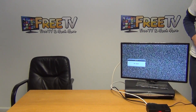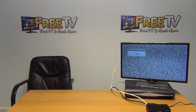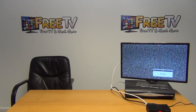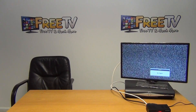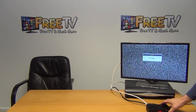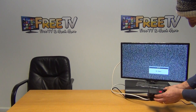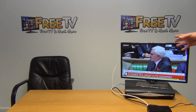We have no output on the television — so there's something obviously radically wrong. But actually it's quite simple: I have this television pre-tuned already. I went into the tuning menu, put it on the analogue tuner, and tuned it in to work on channel 68. But I now have the modulator set to 69, so it won't work. If I go down one channel — there's the picture. The output from the skybox is now displayed.